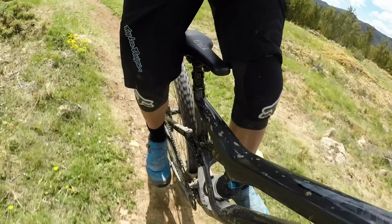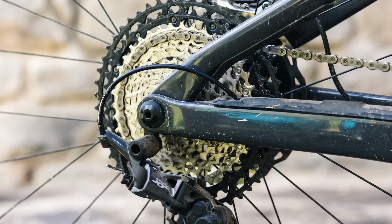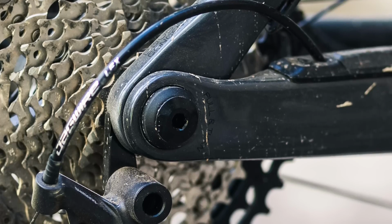boost. This means that the most rearward pivot, the one that would be on the chainstay, is actually located around the rear wheel's axle. And the axle that holds the wheel in place actually holds the whole rear triangle together. This, in theory, Orbea say, makes maintenance a little bit easier because it's easier to get to those bearings.